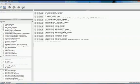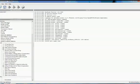If we look at the very top here, it's collapsed by default. If we expand the ROM info tree, you get some more information about your ROM image. In particular, one thing you should know is your internal ID for your ROM. This basically is a version control that Mitsubishi has attached to their ROMs. And there are several different types of versions. And depending on your year and your specific model, your internal ID, your ROM ID, will be different. But it's good to know, because